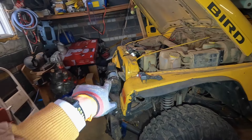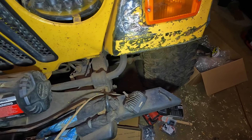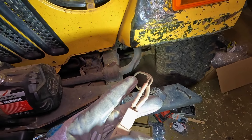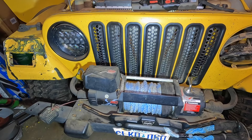I've already got a little bit done up front. I took off this weather stripping because when everything wasn't sitting properly there was a big gap in the hood, and the last thing I needed was to catch air in the hood and have it lift — because 23-year-old rubber latches aren't always the best option for holding down the hood. But I have a solution for that. I took off all of that weather stripping all the way around. I unplugged this light, and these ones are going to get unplugged and taken off. The winch is going to get unhooked from the battery so I can pull it off. Then we're going to take off this bumper and put on the new one.